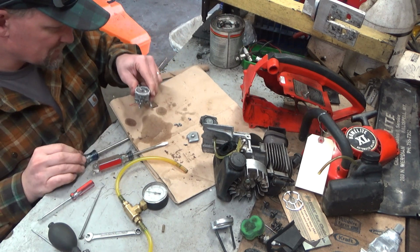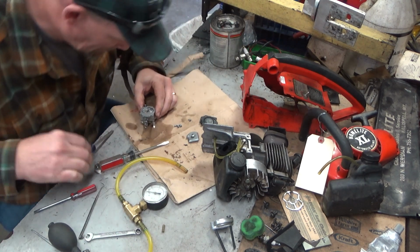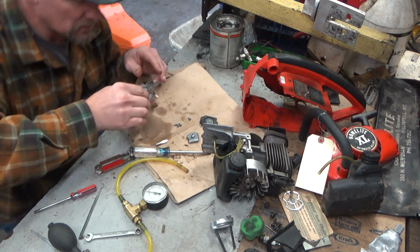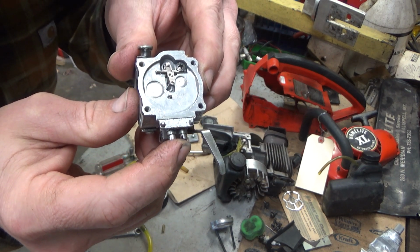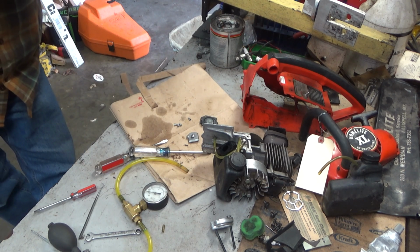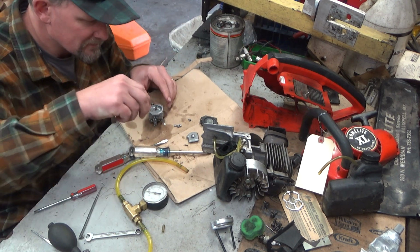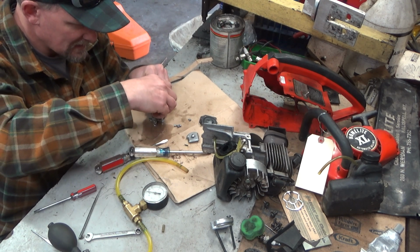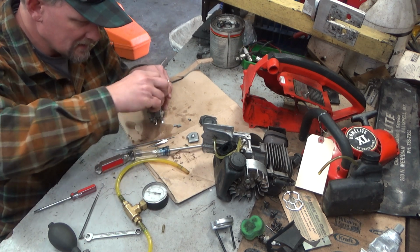Oh, okay. I've released enough screw tension. Now you can see it. See what that damn spring did? These are hard to align. And that's what it was. The spring is aligned with the arm properly, but it didn't drop down into its cavity right there. See that? It needs to drop down back here. So this inlet arm is designed for different types of carbs, several different Zamas. So the spring is going to actually align back where this disc drops through. I can understand 100% how this happened. Let's see if I can do this without taking... No. I can't do it.